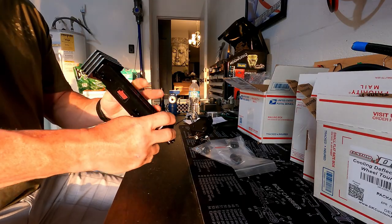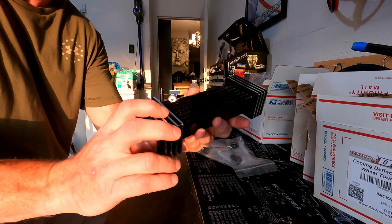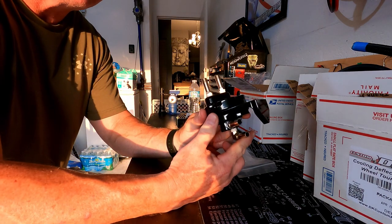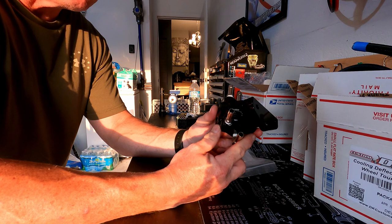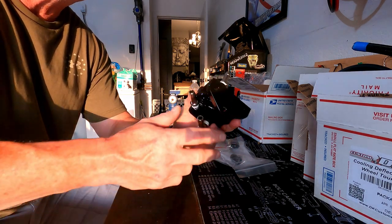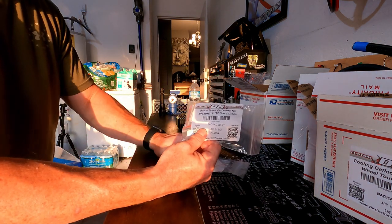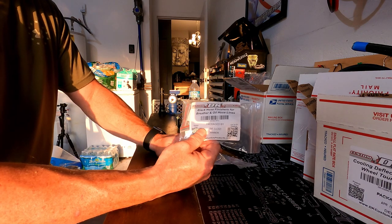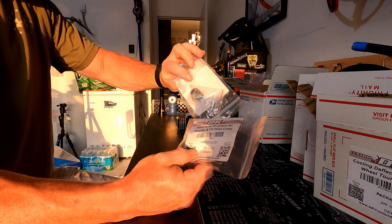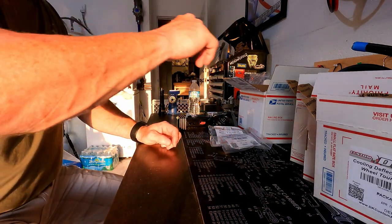Okay, we have the oil cooler itself. Nice little unit. This is how the oil filter is going to be redirected. The oil is going to be redirected towards the new filter location, which is behind the primary case. So we got that. We have four black hose finishers for the breather and oil hose lines, which the breather is something I'm going to be doing next.